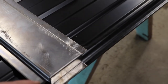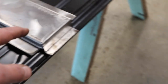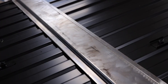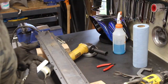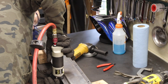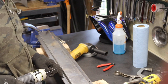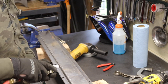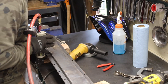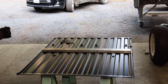So I think I am gonna shave a little bit off each side so it fits in center. I'm thinking maybe one weep hole on either end so if water does get up in there it's got a place to go. One thing I don't have a feel for is whether this Harbor Freight spot weld punch will make it through — and yeah, it makes it through! The problem with these is they're not very deep, but hey, it punches through the metal. That makes prep almost fun now that I have all the spot weld holes punched out.